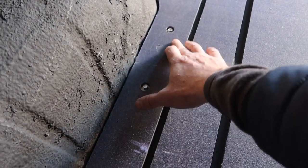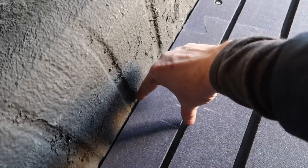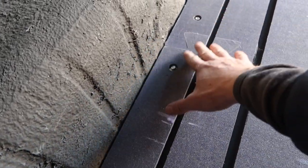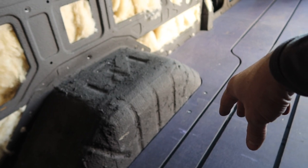My batteries are going to be here so there's going to be a lot of weight, and I wanted the whole floor secured down. This joiner right here was a little bit loose, which also had to do with the way the extra-wide dually tires are set up with the ribs - there was an extra wide gap. I was able to secure those down, had to cut them off and prime them from underneath so they don't rust. I'm here to show you my process, mistakes and all, and I'm learning - if I made another one of these floors I wouldn't have these problems. Also I have different layers of kill mat and Lizard Skin causing variations.